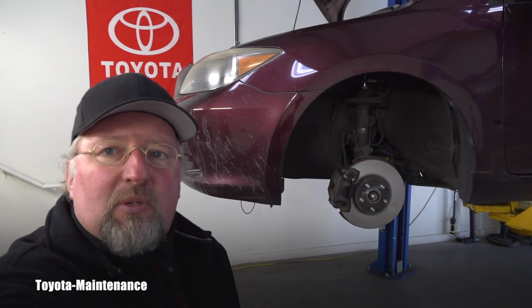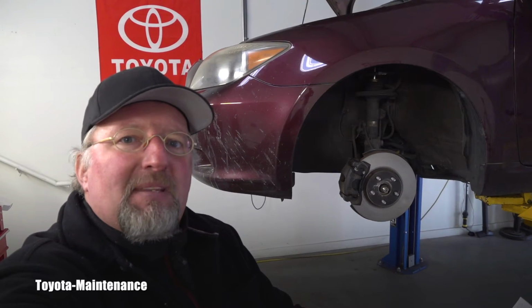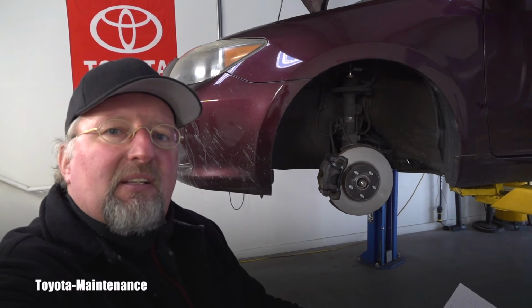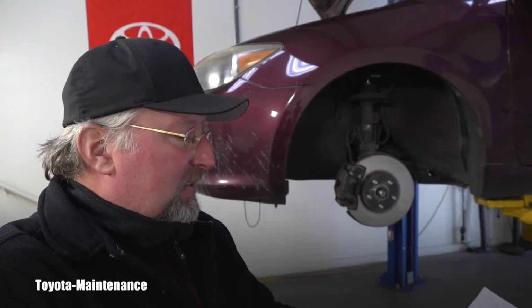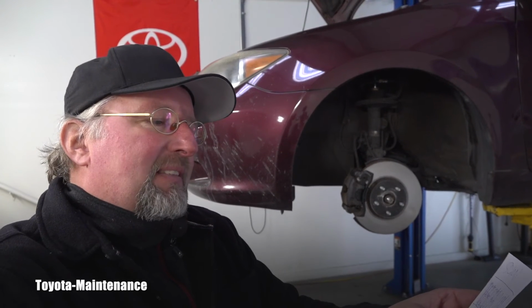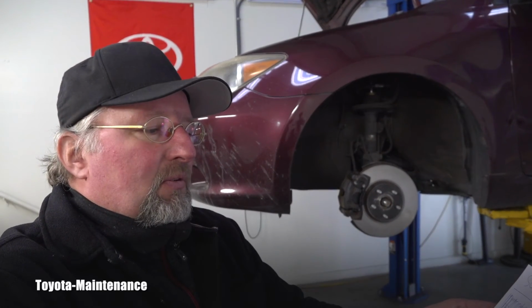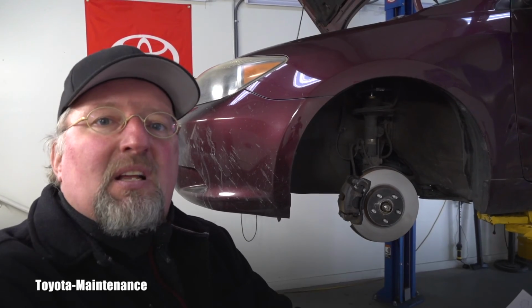Now, these brake rotors, when they are brand new, I have a little cheat sheet here. The rotors, when they are brand new, are 25mm of thickness. This one, the stamp on it, the minimum thickness, is 23mm. Now, I did resurface these rotors today, both sides. And I ended up having here on the driver's side 24.53mm thickness still remaining, and on the passenger side 24.62mm. So as you can see, I'm way closer to the brand new size than to the minimum thickness. This is fantastic. I'm loving it, and I'm sure this will work perfectly for me right now.